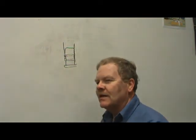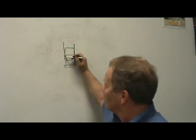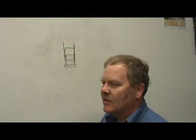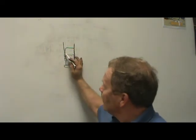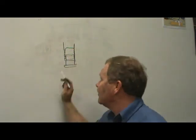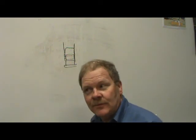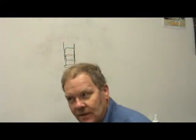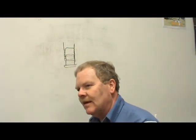But when you put the dielectric grease on there, it basically coats this. The dielectric grease does not conduct electricity at all. It coats this so that no spark can jump anywhere except where the metal is actually touching. And that keeps you from having RFI. That's one of the reasons you're supposed to put tune-up grease on spark plug wires. Now, you might not ever have a problem with that.